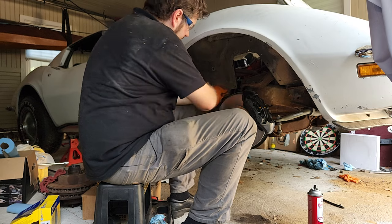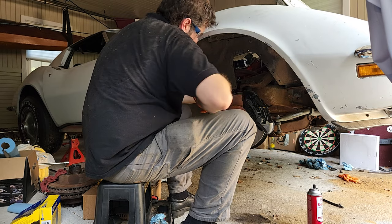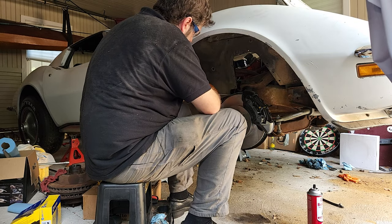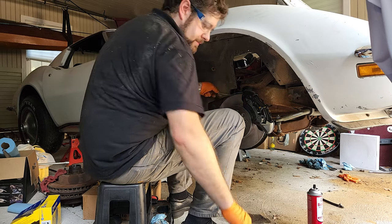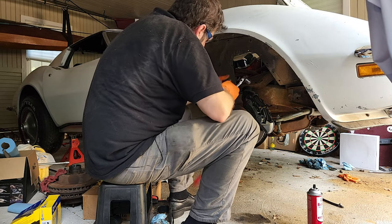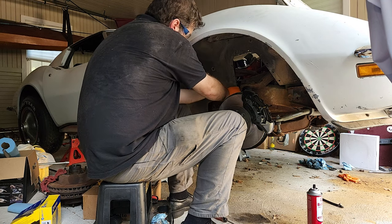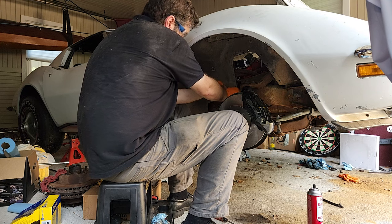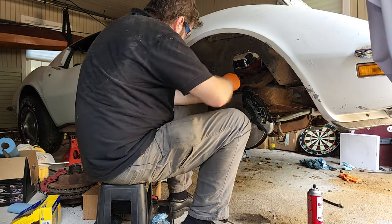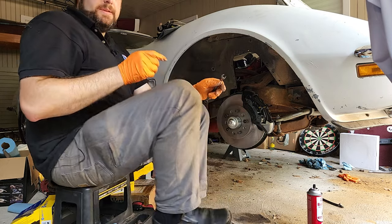All right. So this clip goes on right here — metal clip — the brake line comes in and literally just clips right there. Push it in with a screwdriver, maybe a hammer or hammer substitute. Make sure it's on there, and then thread your brake line connection right there. Make sure it threads, and then tighten it down.